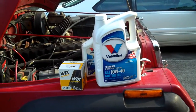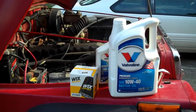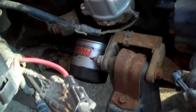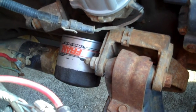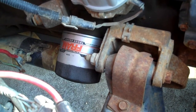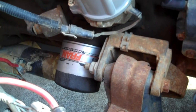Got the filter here — Wix 51085 — let's get started and show you what's in this thing. Way down there you can see a Fram filter. I've already changed the oil on this thing once. I'm not really a Fram fan — I took a Fram filter apart once and saw a paper bypass valve inside them, and I wasn't fresh on them ever since. I was in a hurry at Walmart and grabbed it, but now I'm a little smarter and got a Wix filter.